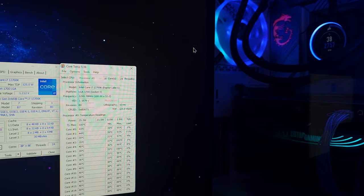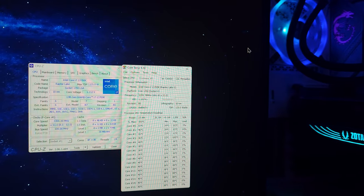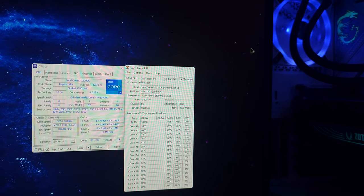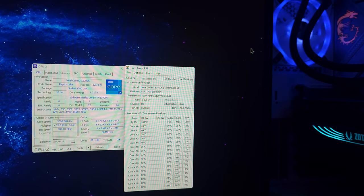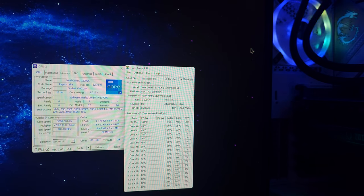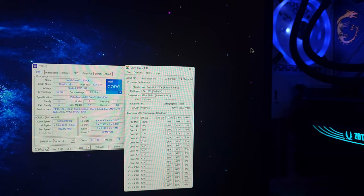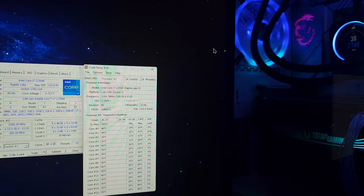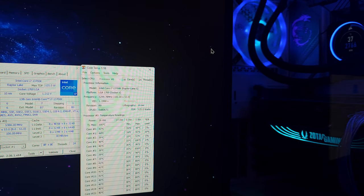Another thing that was causing the issue is the supposedly integrated loading mechanism bracket that comes with the high-end motherboards that we buy for mid to high-end processors. We have to get a contact frame from Thermalright, or you can get some cheaper ones for $17 and under to remedy the issue. That is crazy.